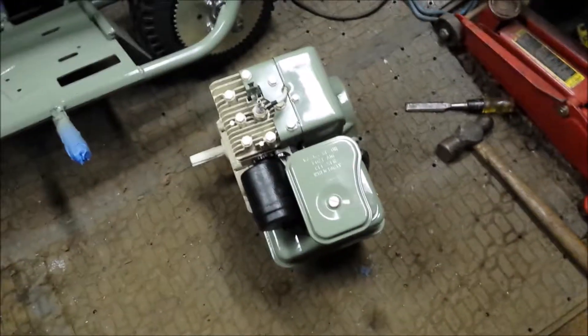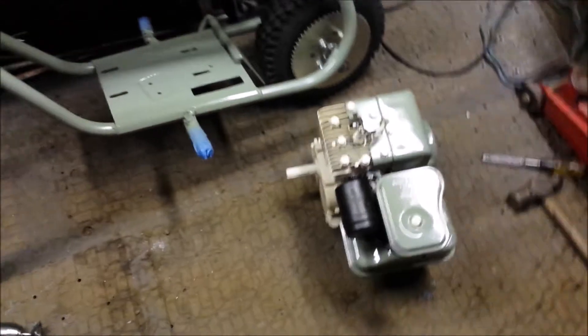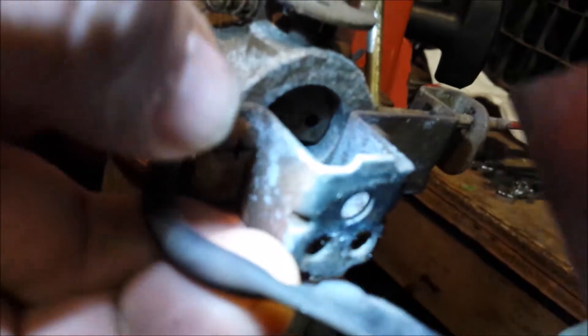It's another day at Dizzy's with my buddy Wally and we decided to put these motors aside because that muffler's had it. This one we put back together but it needs a head gasket for sure — we saw it was leaking in two spots. We got this motor from the Hillbilly Homestead and what we noticed right away is it's got plenty of compression, both wheels turn. But we took off this cover and noticed the primer never worked — you can tell by the crimpness. Look at the bubble — it was wedged right in between this cover here.